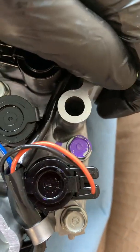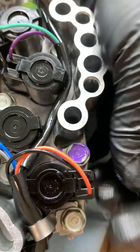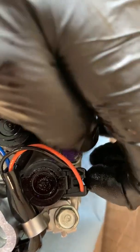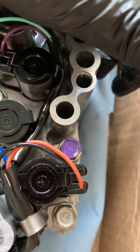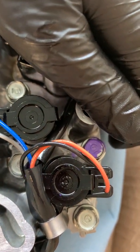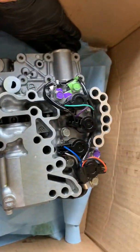Push the wires back towards the solenoid. These terminals in here are a softer metal — fairly pliable. So if you pull this clip away too quickly without pushing these wires back towards the solenoid as you pull away the clip, they will get stuck in the retainer clip and take part of your terminal with them. I didn't break it when I pulled it apart thankfully, but you probably could — they are kind of pliable, maybe slightly brittle.